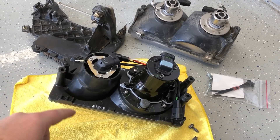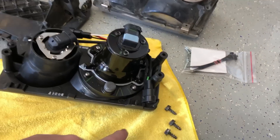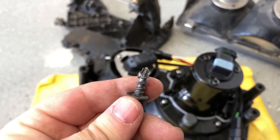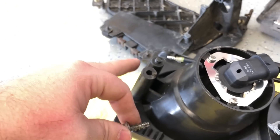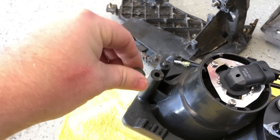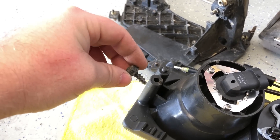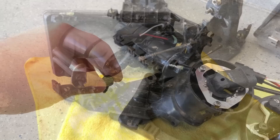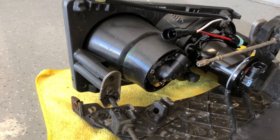Now we're going to take the new headlight housing and install it on the headlight bracket, reusing these three screws. These are self-threading screws so you want to take it easy — nice and slow. Remember these housings are plastic, so go in and out several times to clear the plastic the threads are going into, and make sure you don't strip these out otherwise you're going to be in trouble.